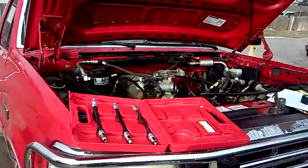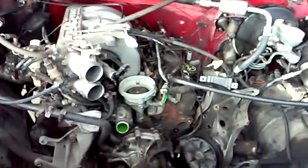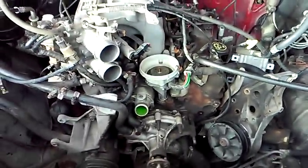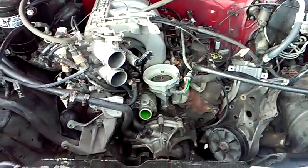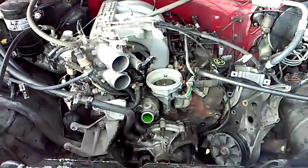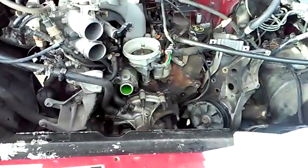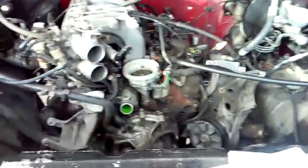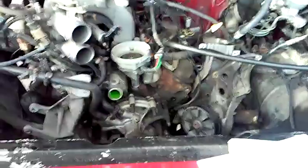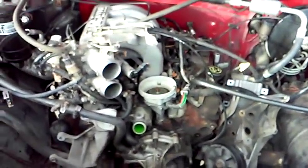We took it for a test drive and confirmed it was running horribly. From there, since the check engine light didn't give us much information, we started pulling the spark plugs. The spark plugs were burnt pretty evenly and worn evenly — though completely worn out. The cap and rotor were what I call 'blasted' — completely gone. So it was obviously time to change them out.